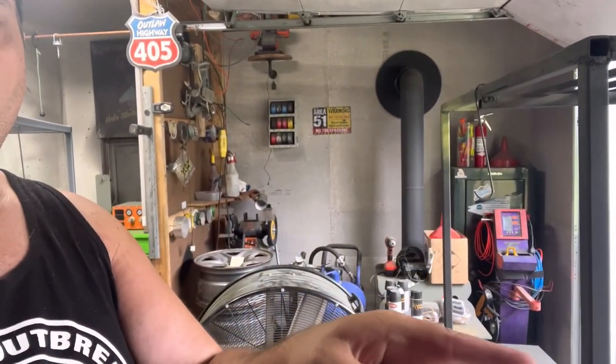But for the nice basic one coaters, the KKHD is fine. And it's funny because this little system of the KKHD, right there, that little box, costs the same price as this whole thing. And the little box, I've done three coats and struggle with four, the KKHD or the Reaper. I've done five, and I mean, I didn't even try number six. I've got at least five with ease. But on that one, you also can control the KV. You can also control the microamps, where the HD, you can't. They say you can. You have to set everything before. You can't set it as you're going along and see all your numbers and everything.